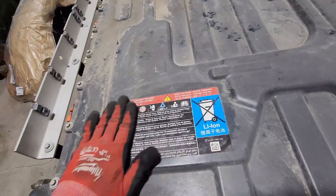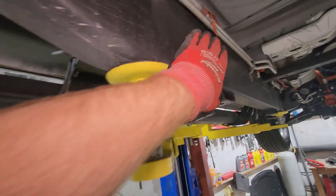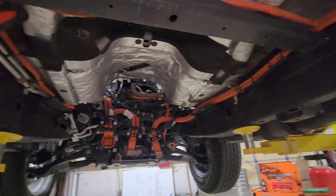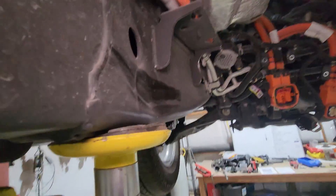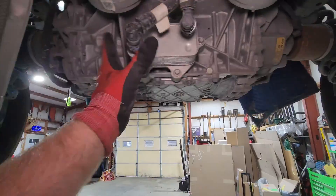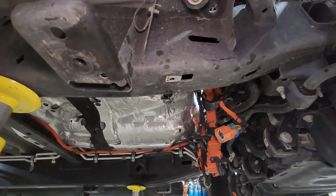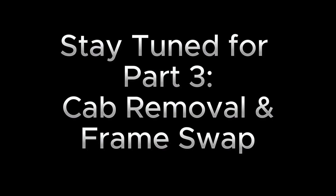Battery's out of the Lightning. Let's take a look underneath a Lightning without a battery. You can see it's a massive, massive frame — these are well built and protected. This main frame is protecting that battery and giving all the structure to the truck. My frame guy said there wasn't a crossmember he was concerned about, but there is a crossmember right here — we just couldn't see it. This frame is bent right here, and it's got the whole front kicked over. Now we get to have the fun of taking all this apart and switching everything over. This whole drive motor looks like it's hanging in there. Floor jack under the bottom, bolt here, bolt here. The next step is to pull the cab — cab comes off just about as easy as the frame. If you want to know if the frame is bent on an F-150 or a Lightning, you can crawl underneath and look at these cab bolts — if this gap is here, it'll tell you if it's bent because it's going to be moved. Now we're going to work on getting the cab off the truck.